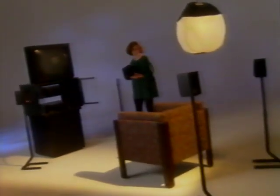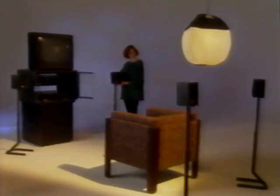The four speakers should go in each corner of your listening area. And if possible, it's good to use a speaker stand or a small table just to get them up off the floor. Some people like to put them on the wall, somewhere around ear level when you're sitting. This way everything sounds better, more like the real theater stuff. The center channel speaker is where you'll hear all the dialogue from the actors on the screen, so you'll want it right by the TV.